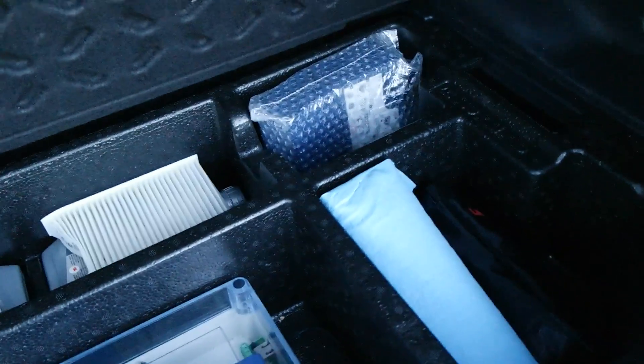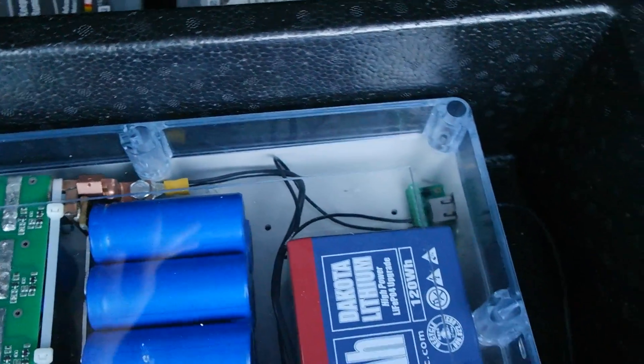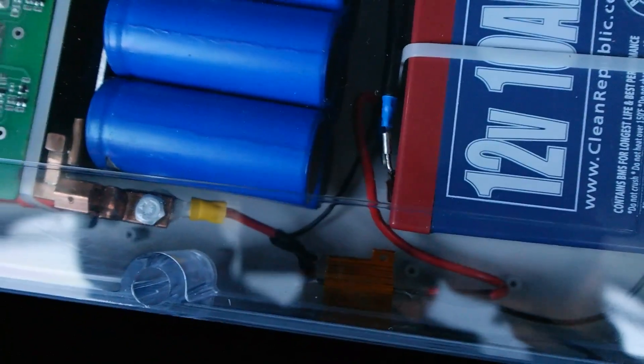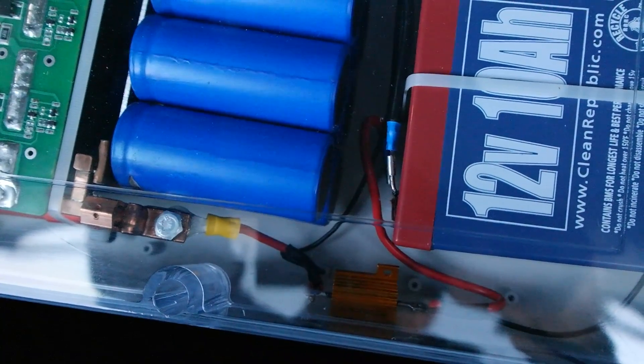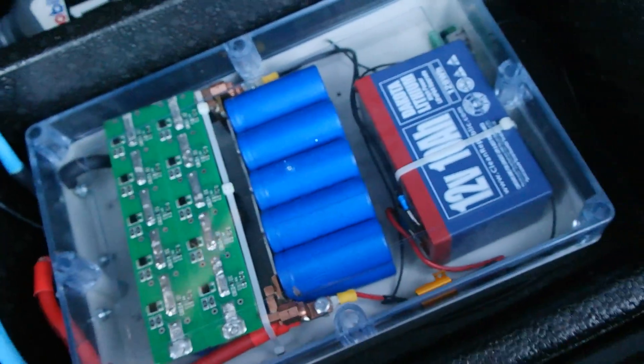Let's look at the quick modification. You can see I've removed the relay unit entirely. I used to have the half-ohm resistor stacked on the side; now it's just this little 25-watt, one-tenth of an ohm rated resistor. It works beautifully, never overheats. Those are the only two changes I've done to this unit and I've never had a problem with it since.